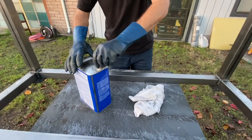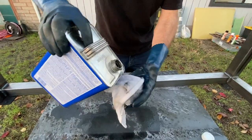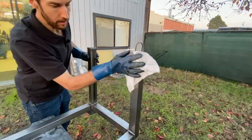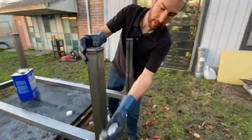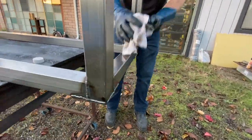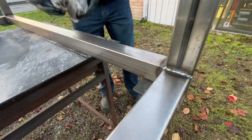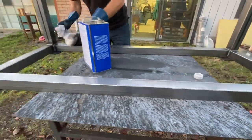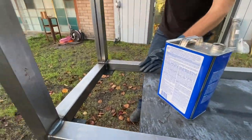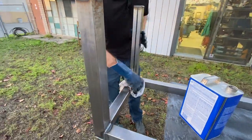The first method that gives you a little bit of scrubbing power is to basically soak the rag in the acetone and use it to wipe down every surface of your project. This helps you get rid of any grease, oil, dust — anything that's going to prevent the paint from sticking. If you have already cleaned the metal or have a really clean part, sometimes you can get away with using a squirt bottle and just squirting the acetone and letting it evaporate.